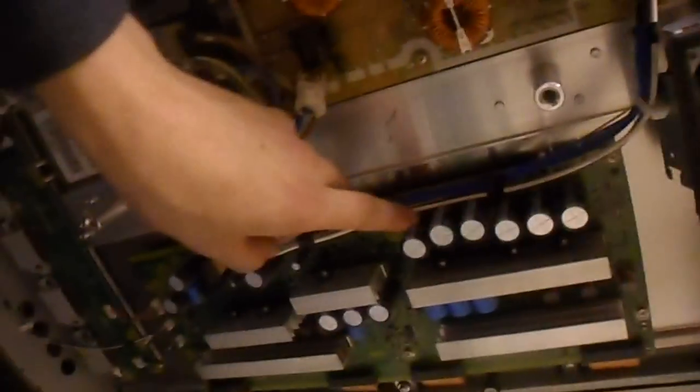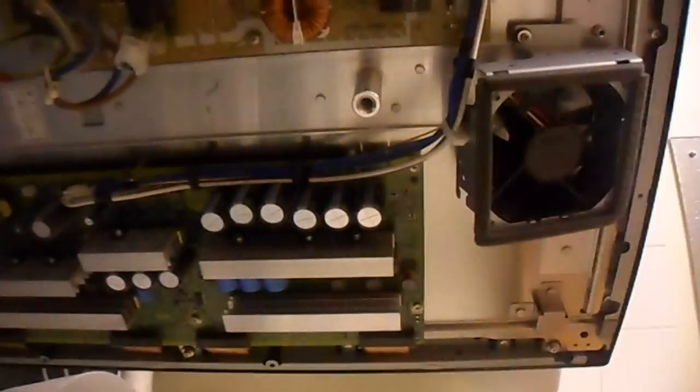Over here we have the SS board. Now I've done the 42-inch PZ80, and I think the sustain boards are very similar, they're not quite the same, but they're very similar. And I noticed these capacitors before and I never could figure them out because they're 100 volt rated. Now I've looked at the schematic, turns out they're for VDA, because VDA power comes into the panel down there.